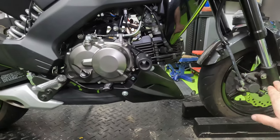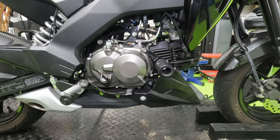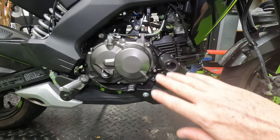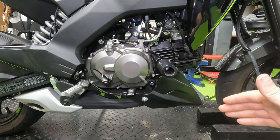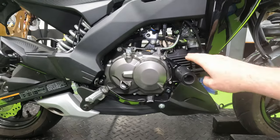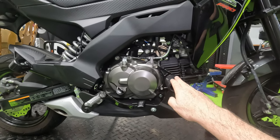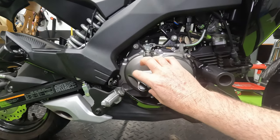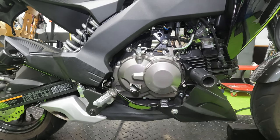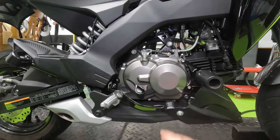You might notice this bike has frame sliders and axle sliders for both the front and rear axles. Those are not requirements — a lot of people suggest them for the racetrack, but there is a mixed opinion. Some people think they become lever arms, and in a low-speed crash, once the bike hits the grass off track it could cause the bike to flip over, causing more damage than if it just slid. It might be a good idea, but it's not a requirement at any racetrack I know of. There are some race organizations that require case covers to prevent your engine cases from grinding through if they meet the pavement. That is very specific to tracks and organizations — again, ask the organization you plan to run with if there are requirements for specific things like that.